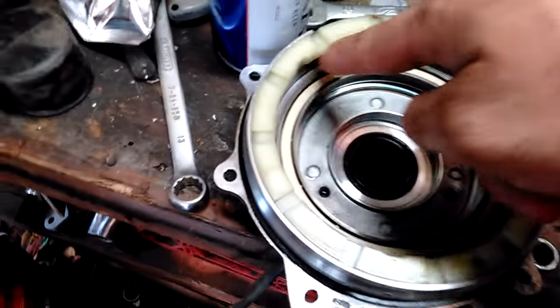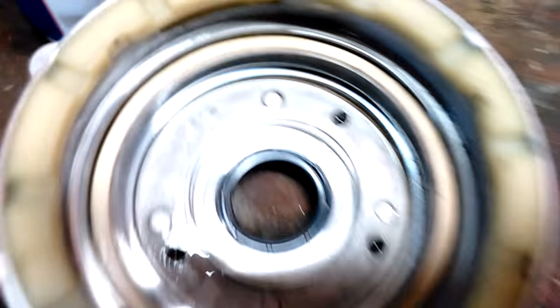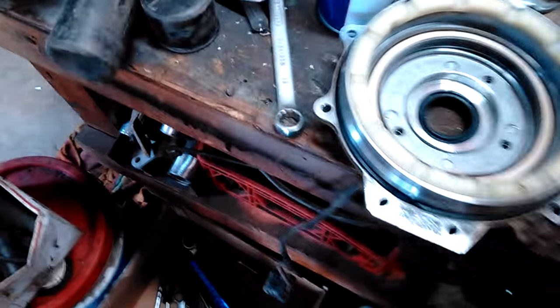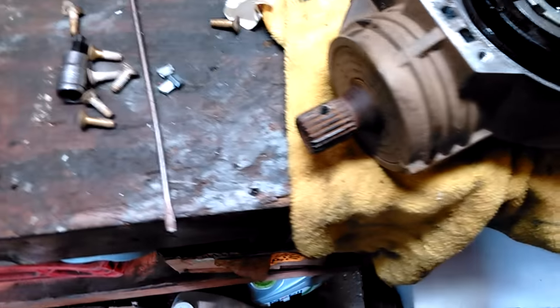So the way this diff works is when you flip the switch, this is a big coil right there. There's a bunch of coils down in there. You can see them, right? And it magnetizes these two surfaces. And these two surfaces, as you can see, line up with the wear marks on the old armature plate. See? So when you press that button, this armature plate, which is usually freewheeling, gets attracted and grabs onto that. So it stops it, right?